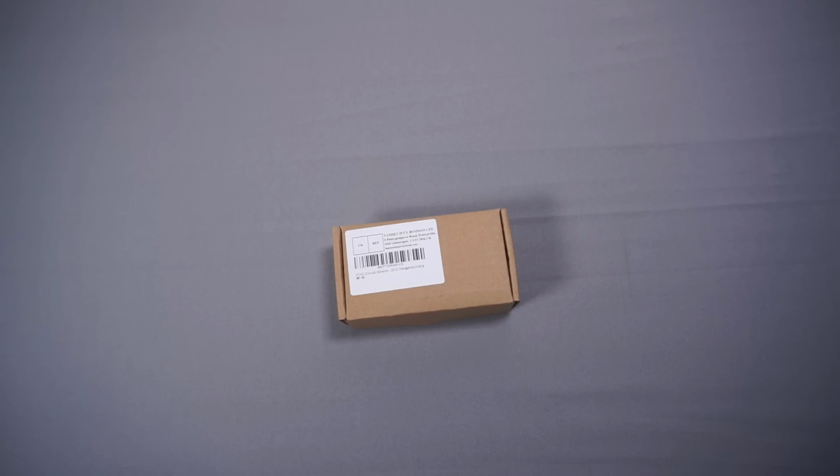So in order to get video out of the Mac Mini, I've got to turn the TV and receiver on first, let the TV sit on the no signal screen, and then turn the Mac Mini on, and then it works fine. I suspect it's due to the FileVault encryption, because the Mac Mini popped up the FileVault screen on boot to ask for the password before it'll decrypt and then start up. And it seems as though if it's not got the TV powered on, it just doesn't detect the resolution and doesn't output video correctly. And I've seen a couple of reports online with people saying the same thing.